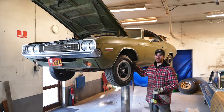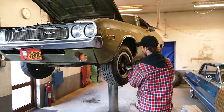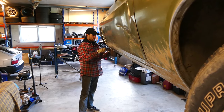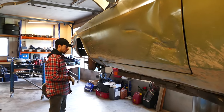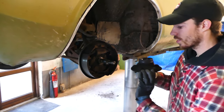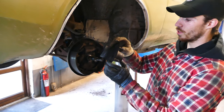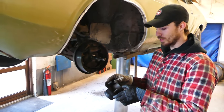I'm going to do all the front suspension right now on the Challenger. Dust cap off quickly, adjusting up the wheel bearing, drum off - that should be good. As you can see on this one, they also converted to a normal wheel stud, so you don't have a right-hand thread and left-hand thread as you do on all Mopar cars up to 1972.